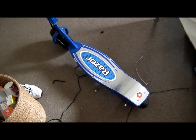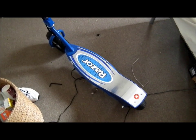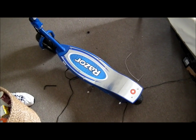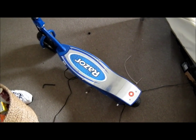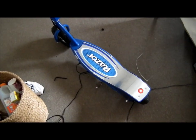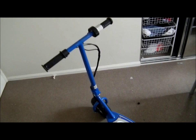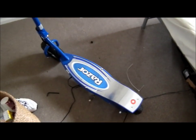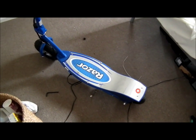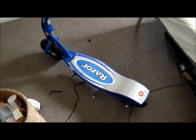Stock, this thing has two 12-volt 7 amp-hour SLA batteries and it says a 200-watt motor on the side, but I believe it's actually a bit more. I think they're just saying 200 watts because that's the legal limit in Australia. I don't know if these actually fall under that classification because they're not designed for on-road use — I think the 200-watt limit might be for on-road unregistered or unlicensed vehicles.